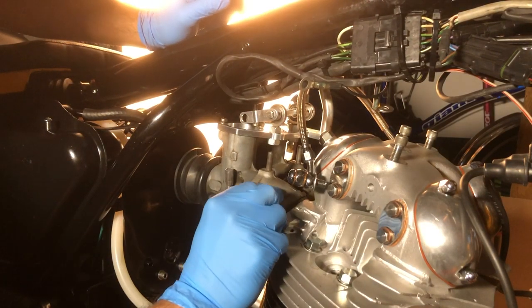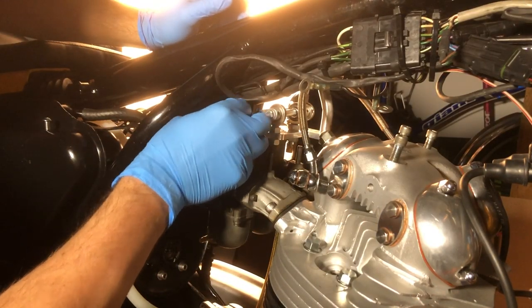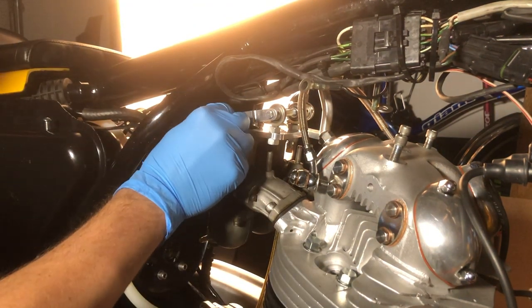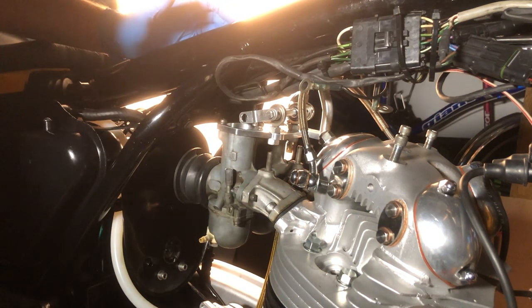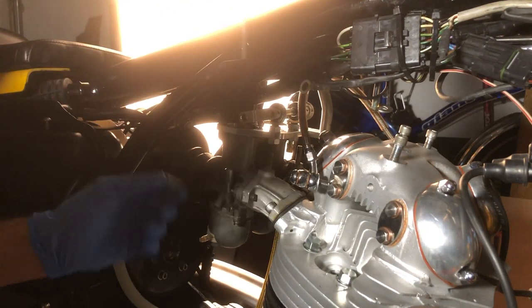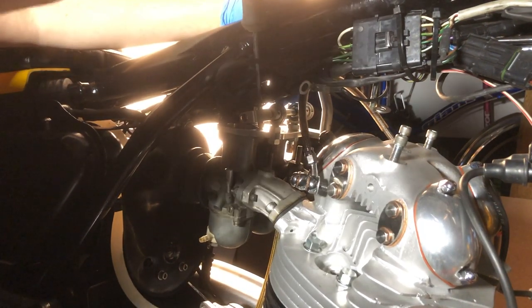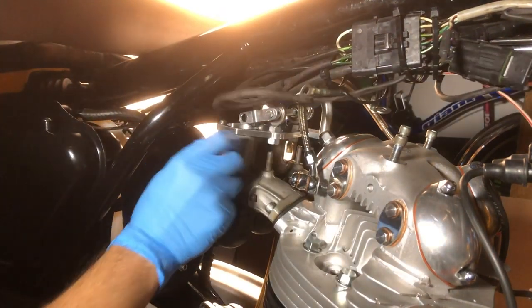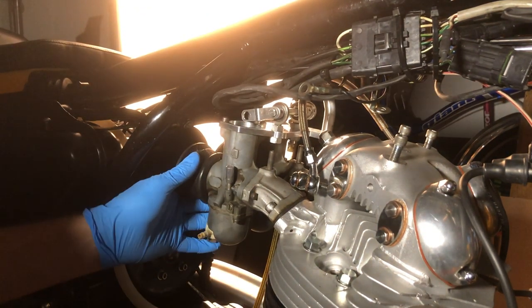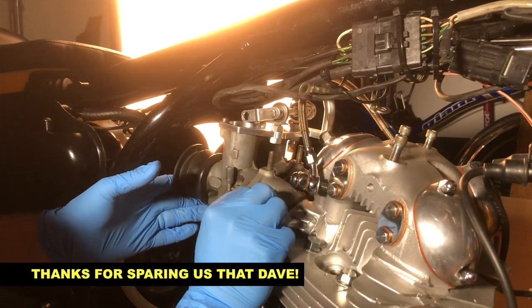The four manifold bolts are a little bit loose so there's some play. I'm going to go ahead and tighten down all four screws into the body — this is just temporary, as the carb tops will go back on. This is to lock the alignment between the four screws and tie the carburetors together, so now you basically have a single assembly. Go ahead and tighten down the manifold.